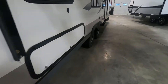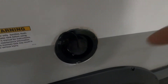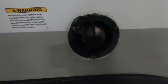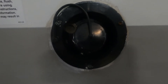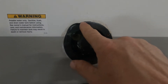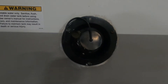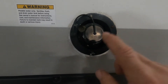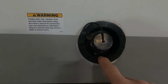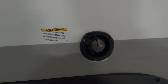Let's say you're going to go camping and you're not going to use city water — you can use potable water. Just above the tires here is your potable water tank. Fill this with a hose; you don't need a water pressure regulator. Two ways to tell when it's full: one, there's an overflow valve here, or two, on the inside where you check your tank levels, your fresh water button will tell you when your potable water is full. Just remember, when you use your potable water, turn on your water pump. Don't turn on your water pump when using city water — it's already pressurized.